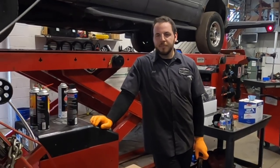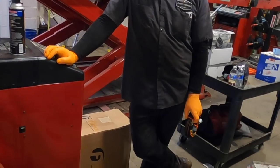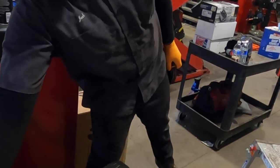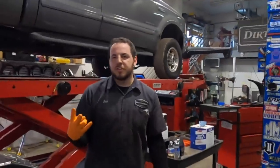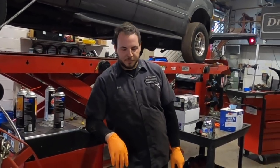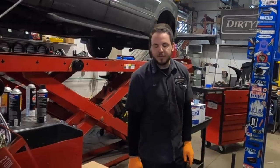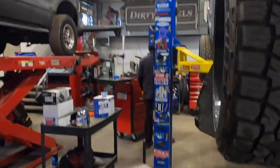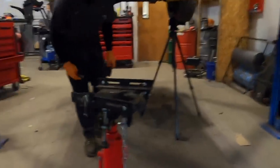It'll also save you some money. The only minor concern we had was the rear water separator — the water sensor is actually at the top of the filter rather than the bottom, but if there's water coming from your tank it should catch it. You've got a sensor in the front too. That was really the only concern, and it's a small one — I've run something similar before without issues. You can drain water out easily, and it's pretty uncommon to get water in your fuel anyway.